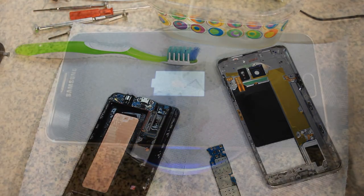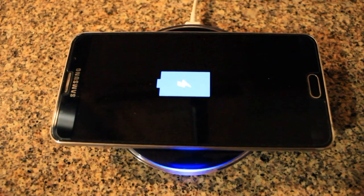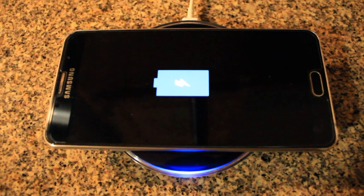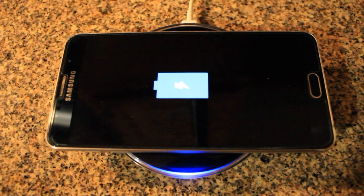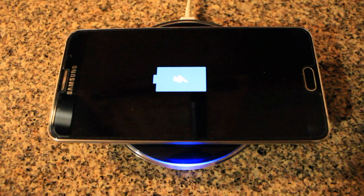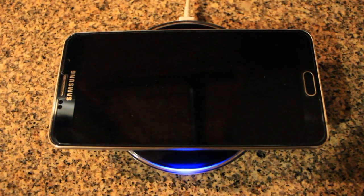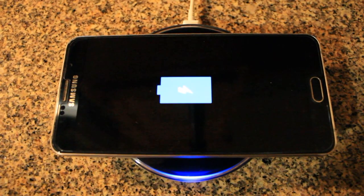So I plug my phone in and this is all I get — charging either with the USB or with the wireless comes on and gives me the charging symbol, but doesn't give me a percentage, and it'll flash off and then come back on. I'm going to order a new battery — I think I saw them on Amazon for ten dollars — replace the battery and try this again. The good thing is it does turn on and the display comes on, but it's not taking a charge, so the next step is to try the battery.